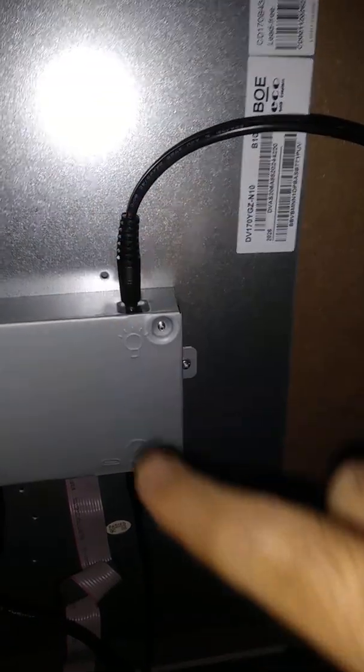But yeah, and I didn't like this either. This wire here, guys, the light cable, goes into the Y splitter, because now you have the J panel back there lighting up the front panel, so you got two things lighting up. Both lights, the marquee and the J panel, go into here, and this has some weight. Everything was hanging and putting pressure on it, and I didn't like that. So I just threw a little packaging tape on it, and it holds really well, so it takes the stress off. No big deal.